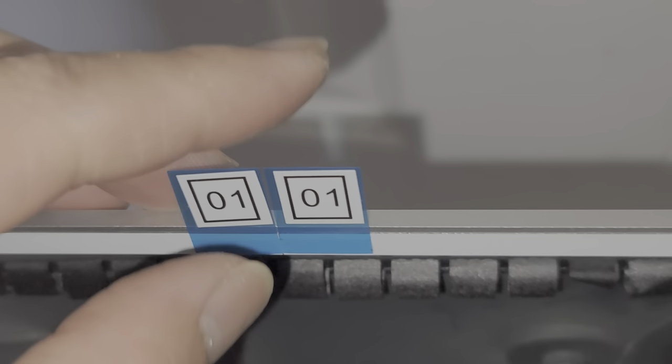After you're done, I like to put tape over the top and around the sides just to wrap it around to keep the screen in place, then start it up and make sure everything works. Once you confirm everything works, take that tape off, open the screen back up, peel these off, reseat the screen, make sure to press all around firmly, and wrap the tape over. Leave that for at least 24 hours to get a good solid stick. That's pretty much it - hopefully this video helped. If it helped, like and subscribe, and I'll see you in the next one.